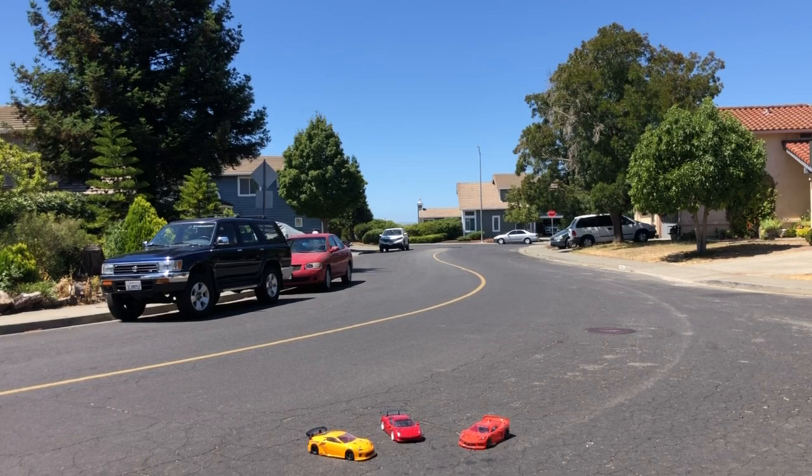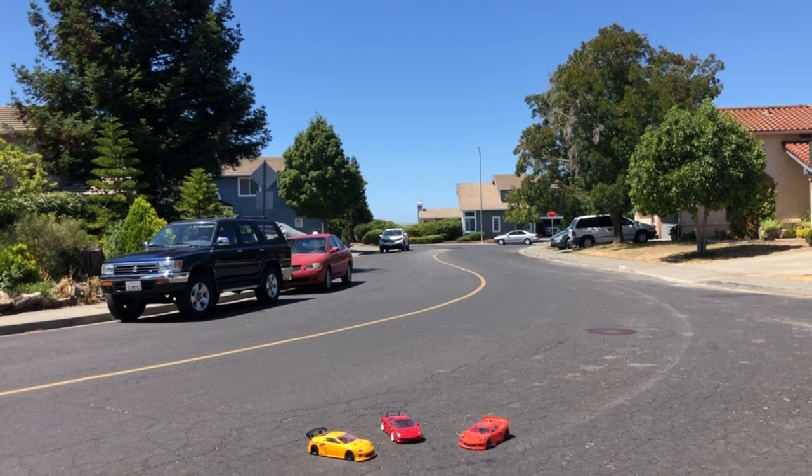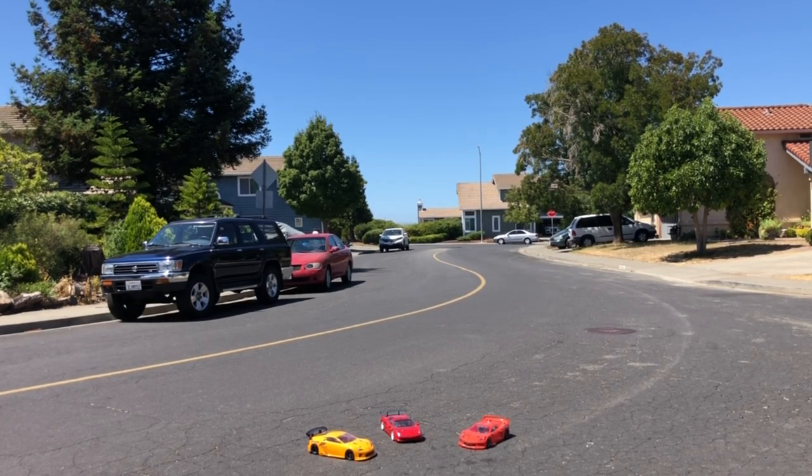And if you guys are wondering, the XL5 doesn't accept a 3S LiPo, the new ones in this case. So how is this XL5 accepting 3S LiPo? The reason is that the XL5 in that LFA is an older model, which accepts 3S LiPo, and the old XL5 has the black heat sink on it.